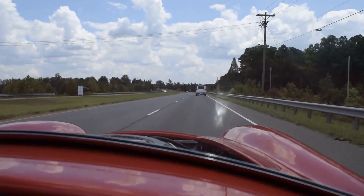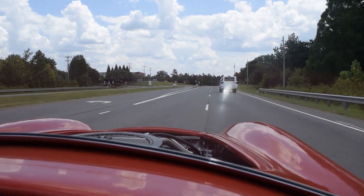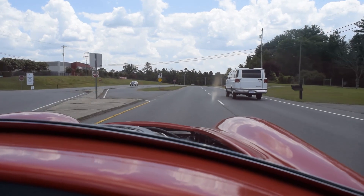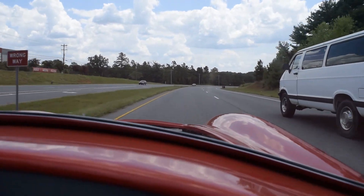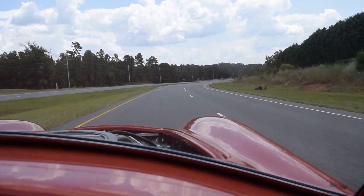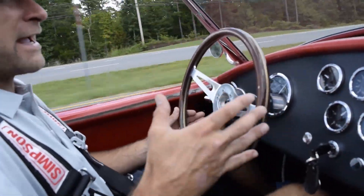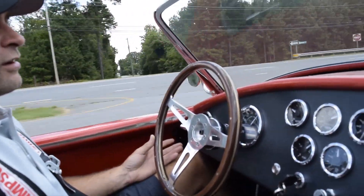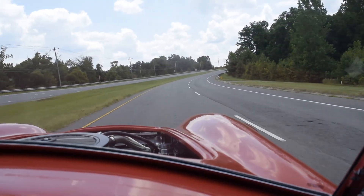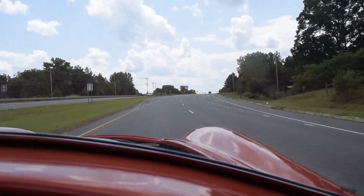The car's got 169 miles on it. Generally we like to put anywhere from 400 to 500 miles to shake the car out. It's brand new — anything can happen. Leaks can start to occur, some hoses might loosen up. It's just about getting the car to seat in and making sure you're entirely satisfied: state of tune, fluid levels, all of it.